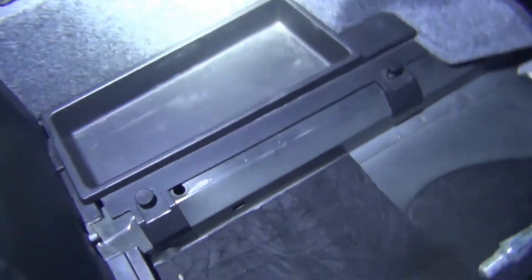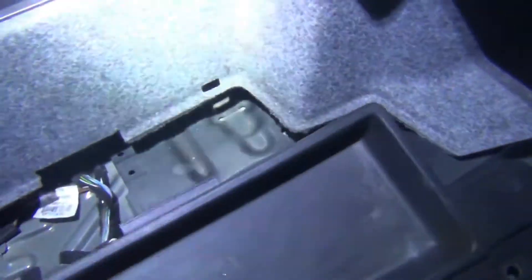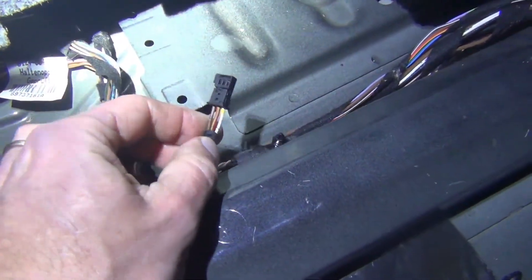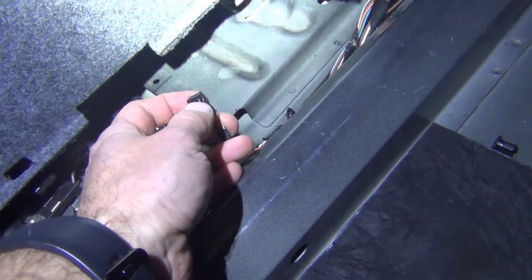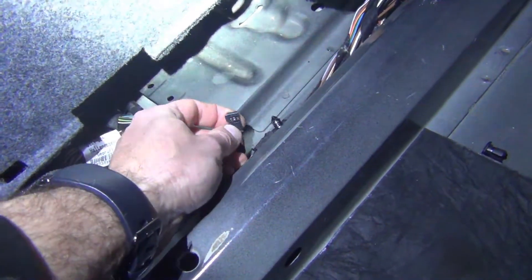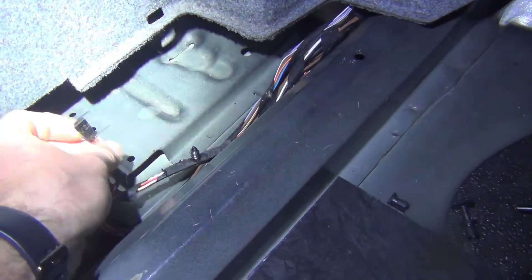Let me show you one other spot that got me once. On the left side of the trunk in an E46 — these clips, if you have this style, just put something underneath and pry them up and you can pop this out. So you have wiring here, and this is actually wiring to add on a CD changer. Here is your I-bus or K-bus wire — this white one with red and a yellow tracer. What happened was there was corrosion in here from a water leak, and the corrosion was grounding across the pins, causing the car to not be able to communicate properly — everything was going haywire, and it was just from corrosion right in this spot. So if you have anything weird with your I-bus or K-bus on an E46, I would definitely take a look at this.